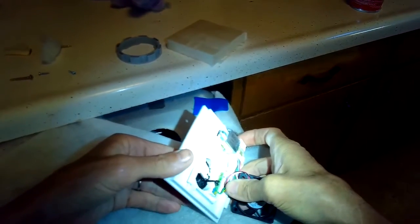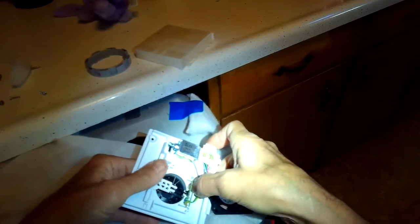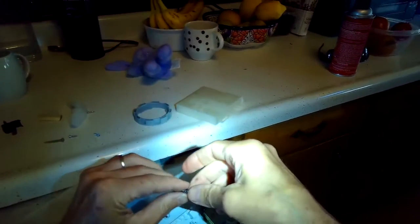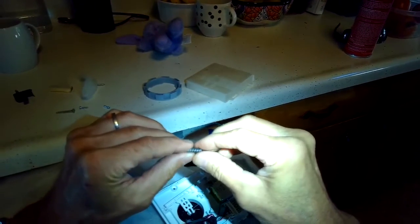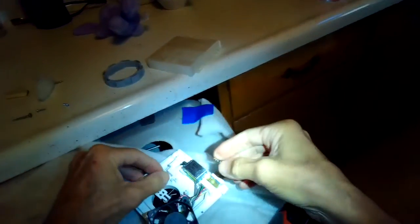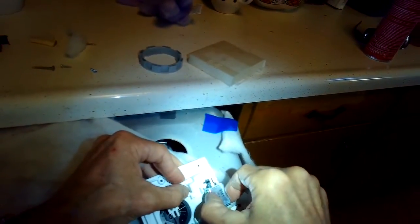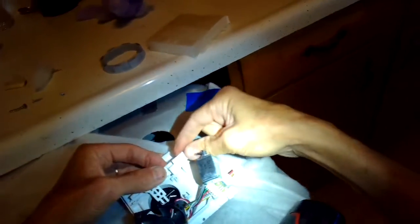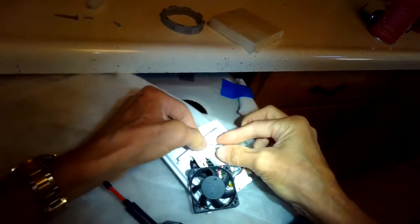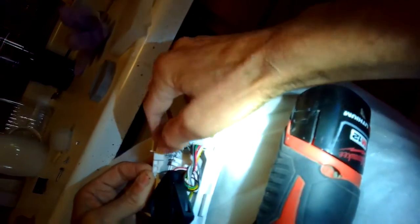And there's a part of the vent, the black piece, that slides up and down in between where the light shoots out. When the vent is closed, part of the plastic vent covers that light, and that tells the computer that the vent is closed. This little spring, if you pull it, you can stretch it out a little bit. It creates more spring resistance, and that can help so the vent can close better. If it closes further, it prevents the light from bouncing from the emitter to the collector, and that tells the machine that the vent is closed and it can progress. But if it thinks the vent is open, it'll cancel and will not progress after maybe 5 seconds.